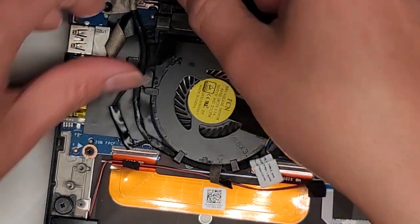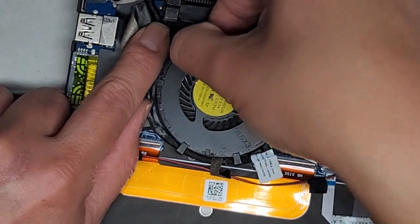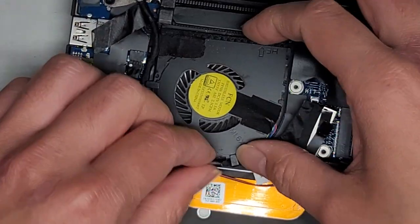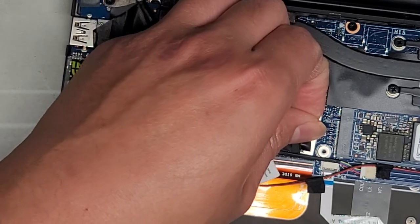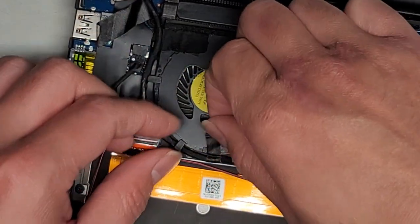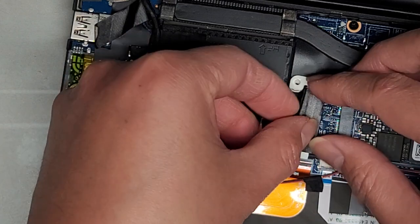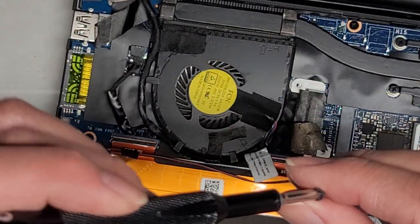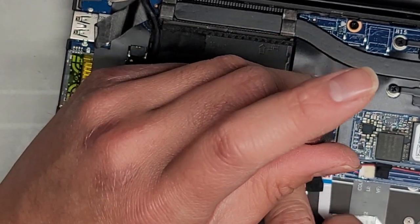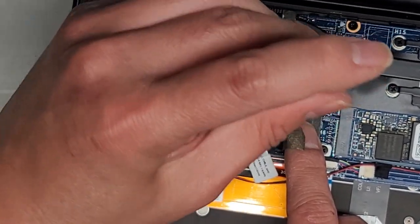Get all of that lined up and guided in. Tape the cables down, tape this piece down. Get the LCD LVDS connector lined back up and click it in — don't let it go into the fan. That's the metal plate with the two screws I was trying to put in the wrong spot earlier. Those screws are wider so they wouldn't even go in, which is good because otherwise I would have damaged the threads. Tighten those in and get the tape back over the top.